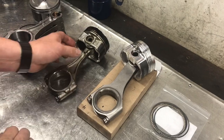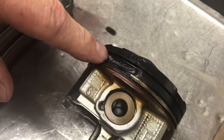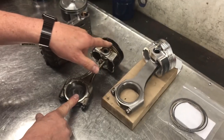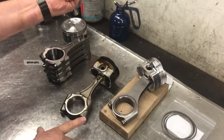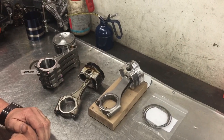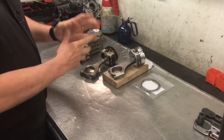What we wanted to show you is what's actually failed on this particular engine — you can see the side of the piston has collapsed, and this caused an engine misfire. We pulled the engine apart and obviously this part was broken. We also noticed during dismantling that the compression rings inside the pistons had lost their tension, which affected the effective compression ability of the engine from a performance point of view. Effectively the engine was very sick in addition to the mechanical failure of the piston. The good news is it didn't mechanically damage the block, and we're able to replace it with aftermarket pistons and rods for a better, stronger, and more durable outcome.